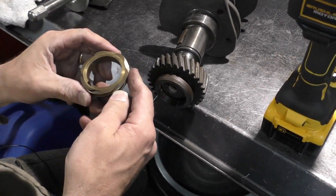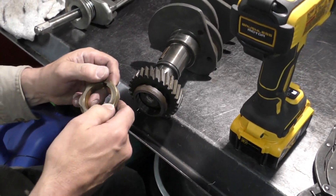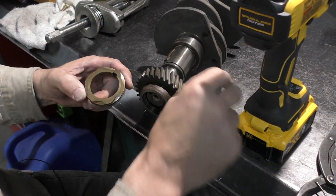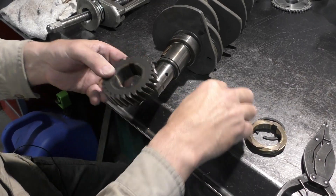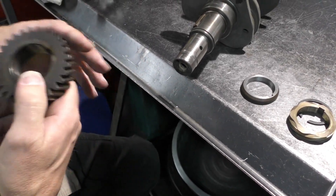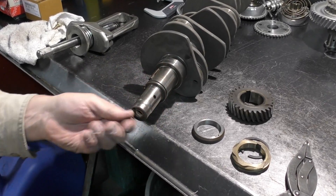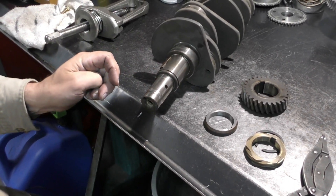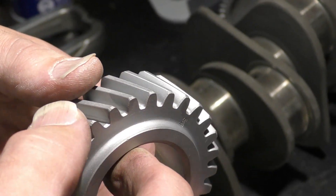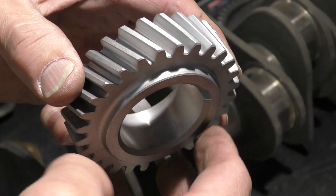Now with that off, to remove these gears I'm going to use my same two-legged puller that I used on my intermediate shaft and just pull these gears off the nose of the crank. There's that distributor drive gear. On early motors it doesn't matter which direction it goes on. With the exception of once you get to the 3.2 liter Carrera engines — there's a Porsche parts emblem and that does need to face out front. That's very important, otherwise you have problems with distributor indexing. This is our zero gear mark, which matches our zero gear on our intermediate shaft. The drive gear looks really nice — no signs of wear on the teeth on either face, and it shouldn't give us any problems with our new intermediate shaft gear.